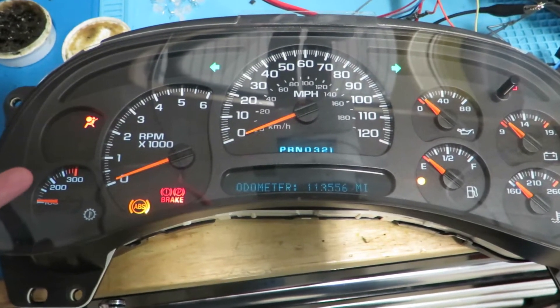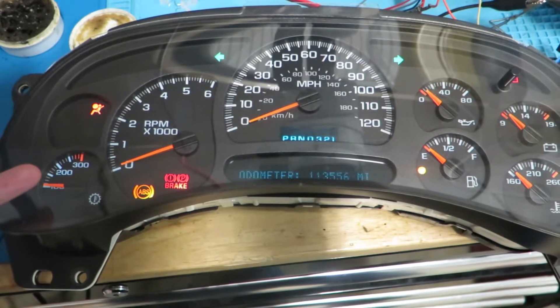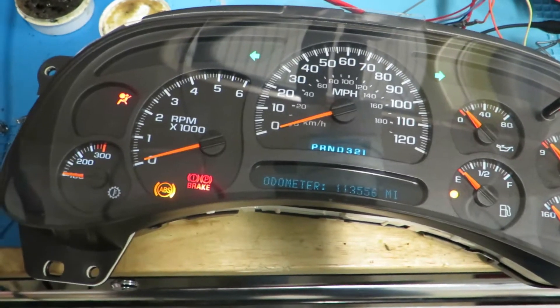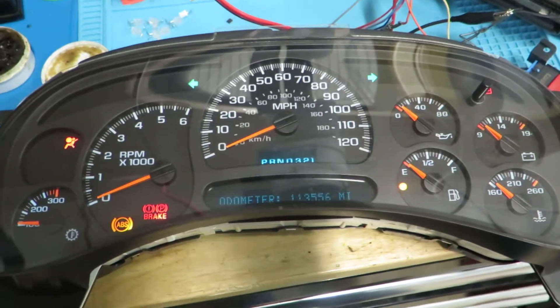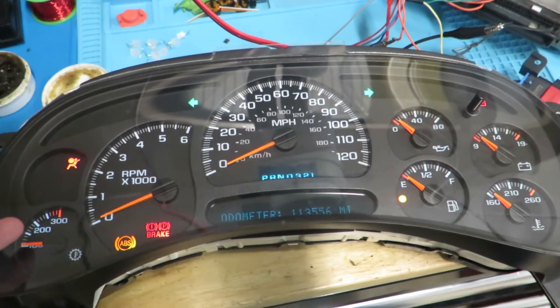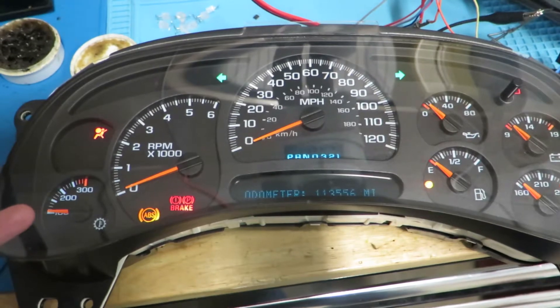If this motor was not actually working, it feeds off of serial data from the PCM or ECU. If it's not sending the signal because it's not programmed, this gauge is not going to move — the rest of them will. Maybe I should do a video demonstrating that by simply adding a stepper motor and simulating that test, showing that it doesn't work. But this is basically how I can validate it.